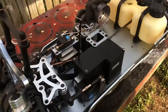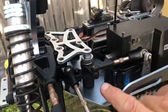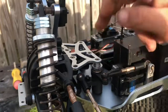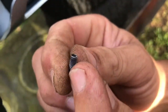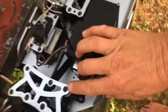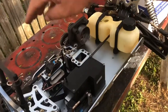Now, in the bottoms of these two steering joints here — we had the top of this one where the bolt was snapped off, and the bottom of this one had got a gouge, and the plate there and the top of this one. I had to drill them out. One I was able to get out, and the other one I had to drill him out — that was no mean feat, that little sucker, but got him out. We now have new screws in here — this one and the new one in the bottom of that one.